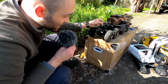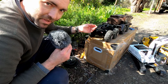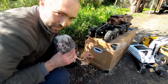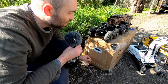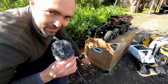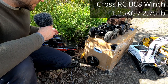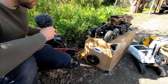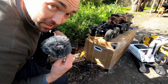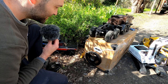Now we're onto the BC8 and you'll see how slowly this 12 volt winch is spooling out. This is OEM equipment as part of the BC8 flagship kit. I don't have a pulley here — a direct line pull would be more scientific, but this is still fun. It's a brushed motor on a worm gear in the gearbox — a decent reduction. Here's two and a half kilograms, which is five and a half pounds. No trouble.